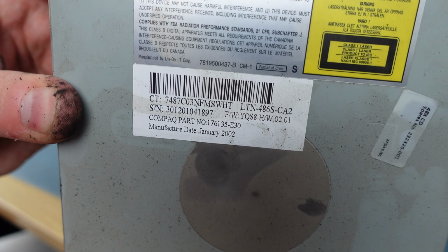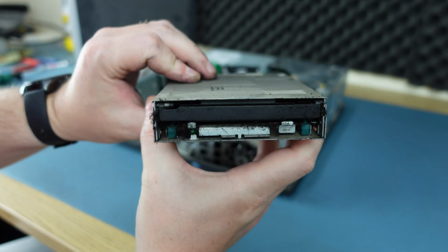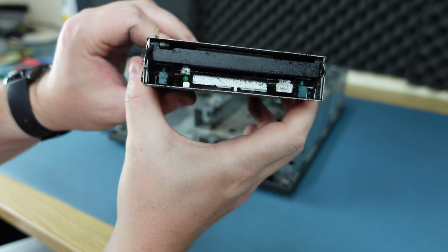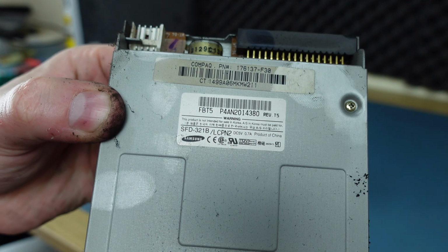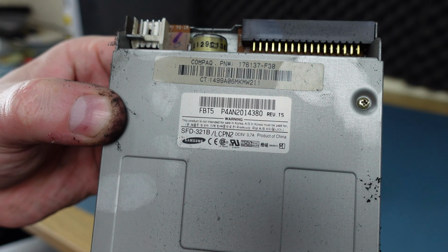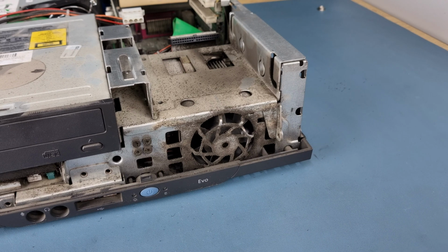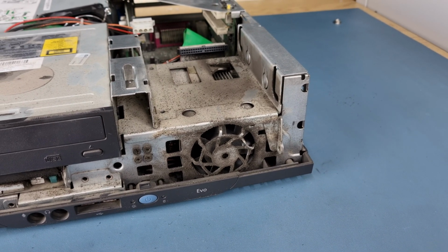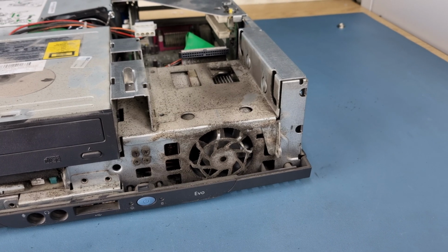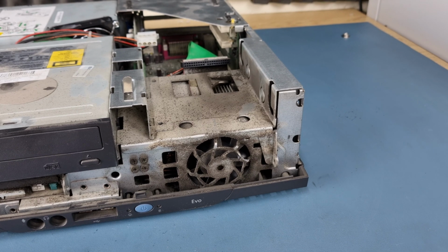This is just a bog standard CD drive, it won't play DVDs or record any media. The floppy drive beneath that was absolutely filthy and probably won't work, but to be honest, on a P4 machine like this, I don't really need it to, so I'll just clean it up and put it back in. On the other side of the hinged section, you can see the spot where an IDE hard disk would be placed. This unit would have originally shipped with a 20GB unit, but I'll probably find something a bit bigger, as the fully patched version of Windows XP that I'm going to use will eat into a large chunk of that space.